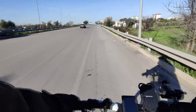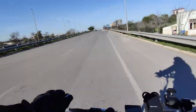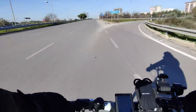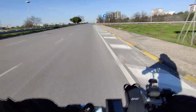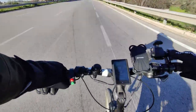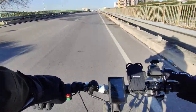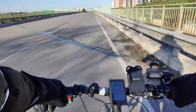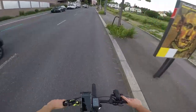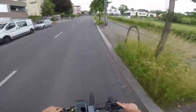Let's spend a few words about the power that you might need. The difference between a 250W and a 500W motor is quite remarkable. On a 250W motor, in case of steep climbs, the effort of your legs would be substantial. A 500W motor will be able to tackle a climb with very little help from your side. Of course the more you help it, the more energy you will save. But in case you live in a not-so-flat area with lots of ups and downs on your way, maybe you should consider the 750W version. I can confirm that living in a mountain town is not the same as living in a flat area. For the second case, even if you have a few bridges to cross, a 500W will make you very happy, saving you a lot of effort.